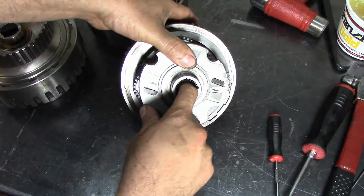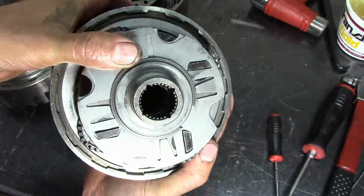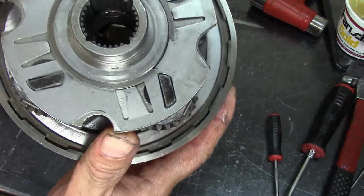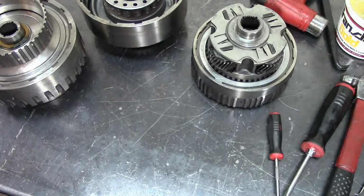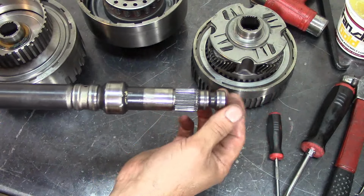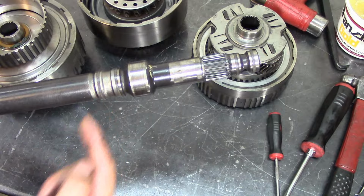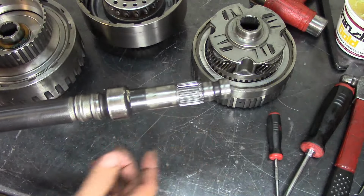And the way you can tell, you just stick your finger in there. No light. Let's see. There we go. A little bit of light. Put that to the side, and now we're going to install our sealing rings here. I'm going to cut them off, and I like to install them in one piece. A lot of builders like to make a slant cut sideways, which is fine, but I prefer to put them whole. I'm going to show you how.